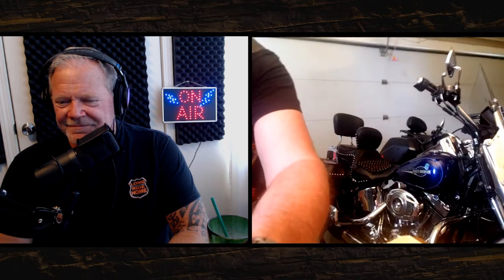Look at the range in your owner's manual and adjust tire pressure accordingly. Beyond pressure, check the tread — you'll see if the wear bars have worn down. If you have spoke wheels, check each spoke: take a wrench and tap it; a nice ping means it's good, a thud means you probably need to tighten those spokes up. That's pretty much it on the tires.